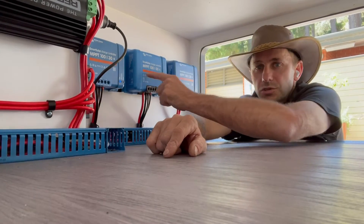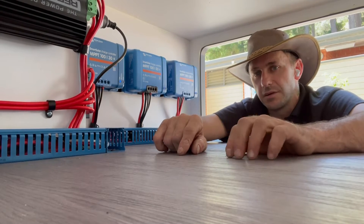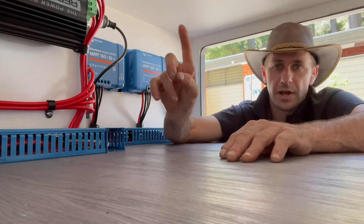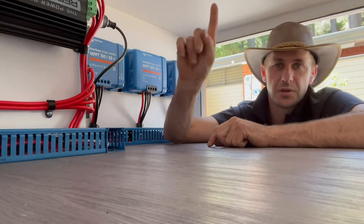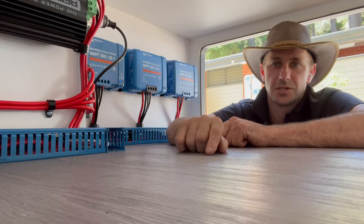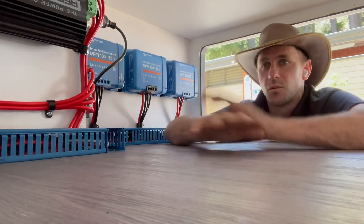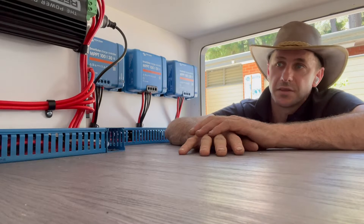These solar controllers will charge at the same time as the DC charger. To put it in perspective, this has an IBIS-3 which pulls about 90 to 100 amps per hour. Even this solar setup is enough to keep up with the IBIS-3 roof air conditioner. The DC charger comes in on top while driving, so these guys can run their air conditioner while driving, cool the van down, and when they rock up at camp they don't have to worry about a stinking hot caravan. Pretty cool setup.